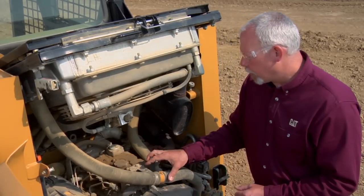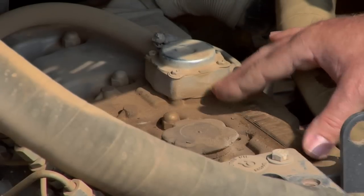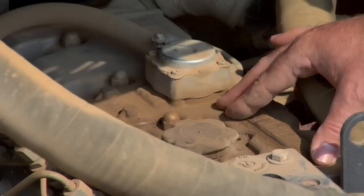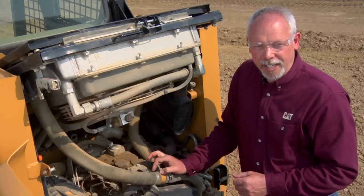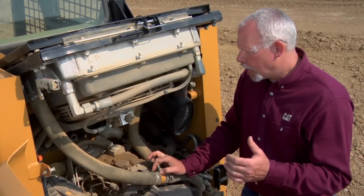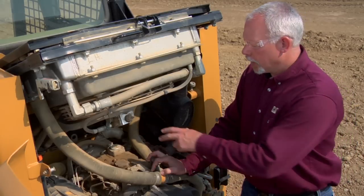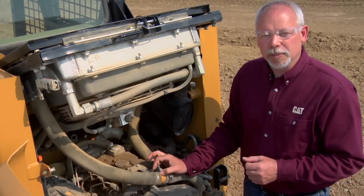While we're on the top here, let's talk about the valve cover. Obviously you're looking around the valve cover for leaks, but a lot of times I see that people, when they do maintenance on these things, will overlook the fact that the valves do need to be adjusted in these engines periodically. That can cause low power — that's one of the biggest complaints we'll see when these valves start to get out of adjustment.